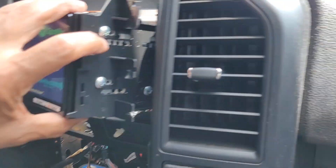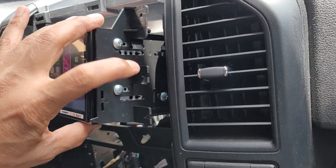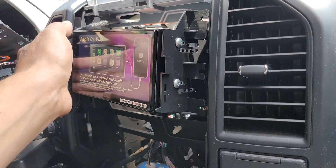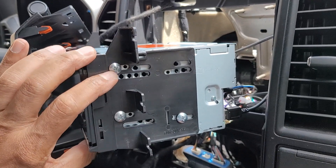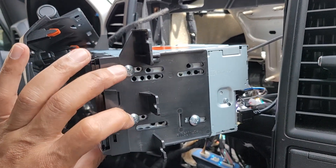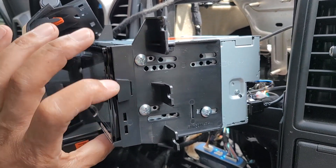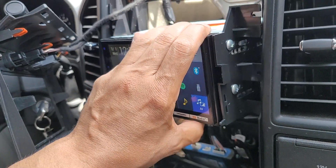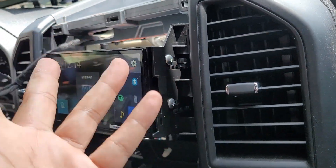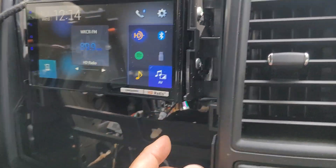To avoid the issue of where do I put the radio and how do I know where it goes — line them up with the three screws. The furthest ones in front, the closest ones to the front — that's what you line up and you push the clip right to them, right to the edge. Most of them are this way. Why they give you the extras is just in case the radio is too long or too short, or it's a different radio — different brands of radios — they give you those options for the side.